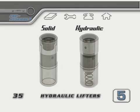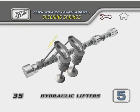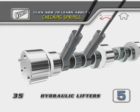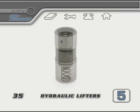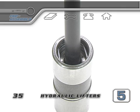If you're not able to get a hold of some solid lifters, you'll have to get some lightweight checking springs from a performance or hot rod supplier to use with your regular hydraulic lifters. When rotating an engine by hand with no oil pressure, a hydraulic lifter is overcome by the valve spring pressure and the movable plunger inside the lifter will sink down as the cam begins to push up on it. This would keep the valve from opening all the way for a proper piston-to-valve clearance check.